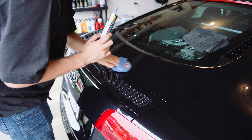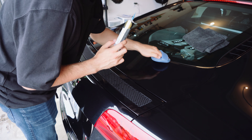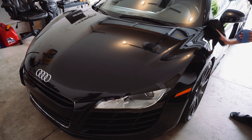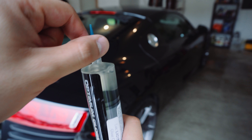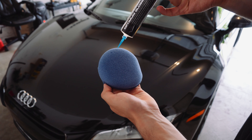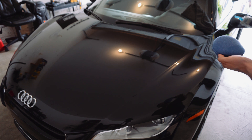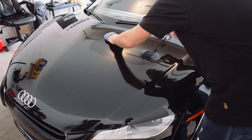It's super important that the paint and the ceramic coating are the only things between themselves so there's a proper chemical bond, and you get the actual advertised durability. If you apply a ceramic coating on a car that hasn't been clay barred or polished, you're not going to get that durability the manufacturer is claiming, because it's not properly chemically bonding to the clear coat. Once all that is done, you start one section at a time — put the syringe needle on the tip and take the applicator pad, putting maybe 10 to 12 drops of the coating on the foam applicator pad on the edge.